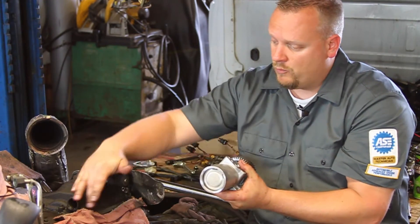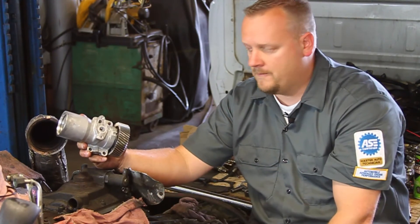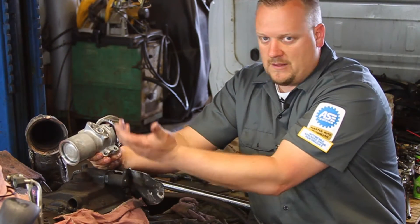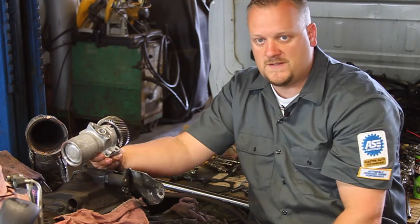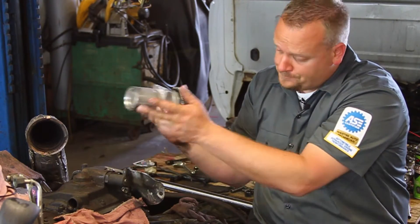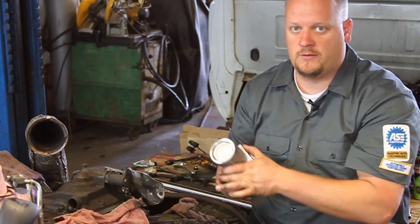Now that we're down to it, we're going to remove a couple bolts here, get this housing off, and we'll find the pump submersed in oil. It's gear-driven off the back of the engine, so we're going to go in there, suck the oil out, clean up the surfaces, put some new O-rings in, and put the new pump in place. While we're in there, we're also going to replace the IPR and the ICP — it'd be a shame not to do those while we've got them open here. We'll button up the job and resume what we were doing originally.